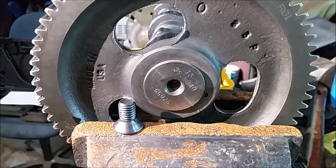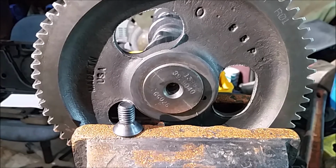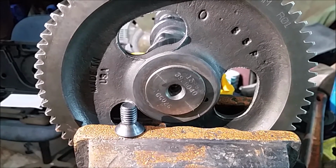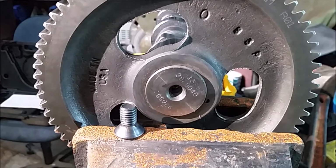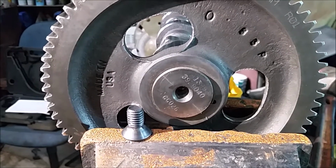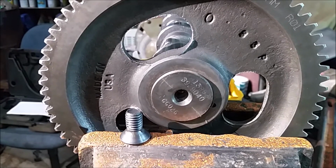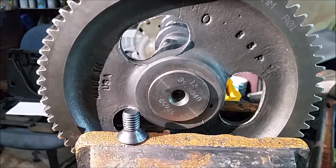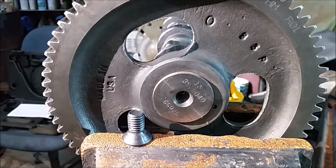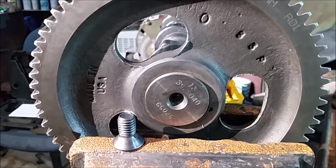So we're pulling the 188-220, the Hamilton cam, back out of the black hole in order to try to bring some power back in a little lower for towing and whatnot. So we have a stock 12 valve cam here. And of course, one of the problems that you can run into with a stock cam is that you can get gear walk. So you can actually get the cam gear to pull off the front of here or start pulling off the nose of the cam.